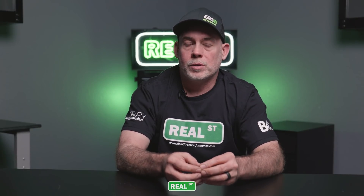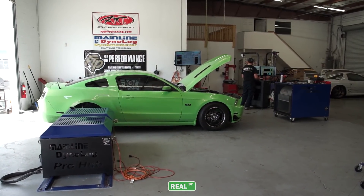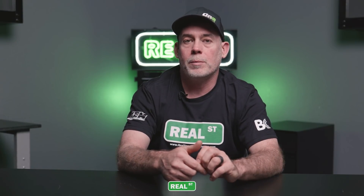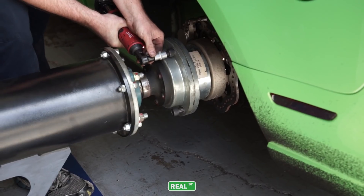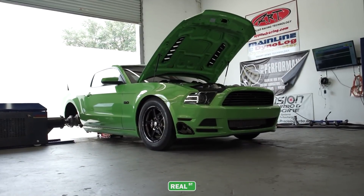Load-bearing eddy brake dynos are a completely different beast. They use basically what would be a high-speed train brake. You flow electricity into that brake and try to slow or hold the vehicle back. You can have an eddy brake dyno where the wheels and tires are turning drums, or you can have one with hub fixtures that actually bolt directly to the drive axles of the vehicle, eliminating any traction problems.